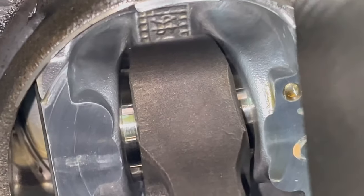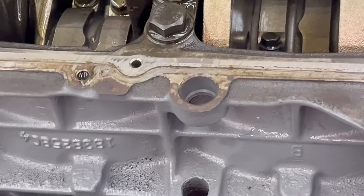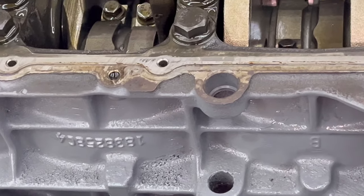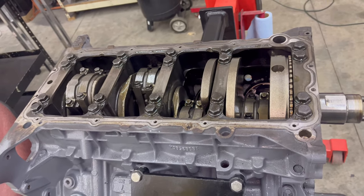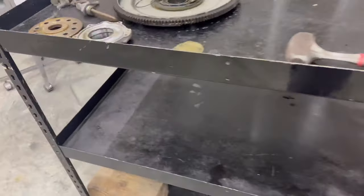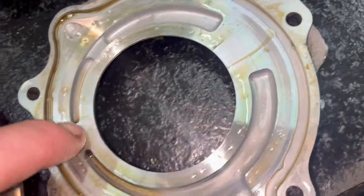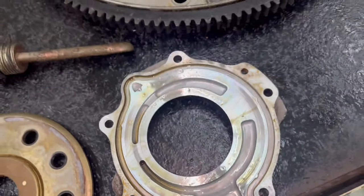It looks pretty smooth. And with that said, now we've got about 2/1000ths of cylinder wear. And I think we might do a refresh, might do ball hone with rings, lap the valves in, possibly no bearings. Because if we're not going to take the crank and go have it worked, then we're going to put it back together with the old bearings, as long as there's no damage. Which, how that low pressure pump cover looked over here, that says we're going to have some wonderful bearings. There ain't nothing wrong with them bearings. Them bearings will ride another 500,000 miles. I would put money on it. Well, as long as there's no failure. There's always that little phrase right there.